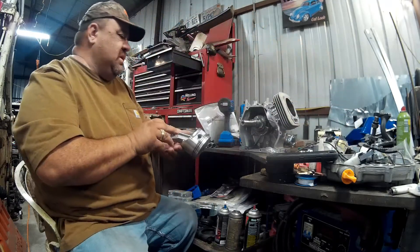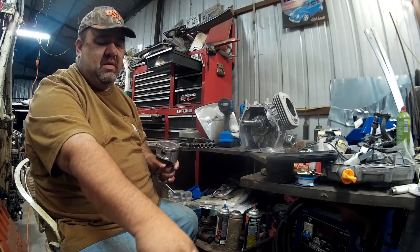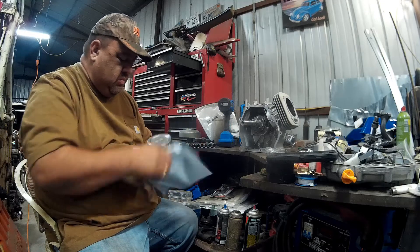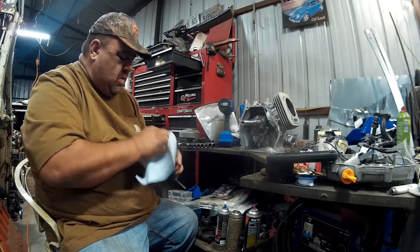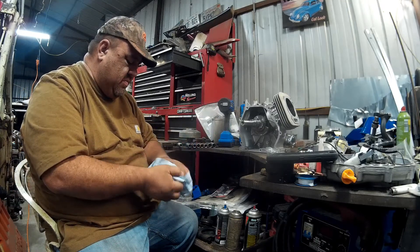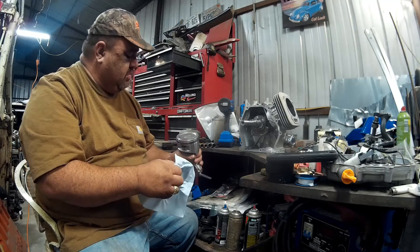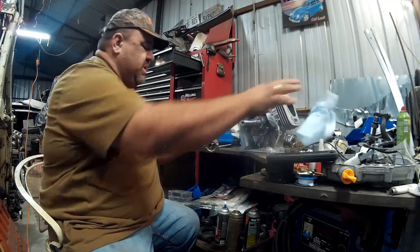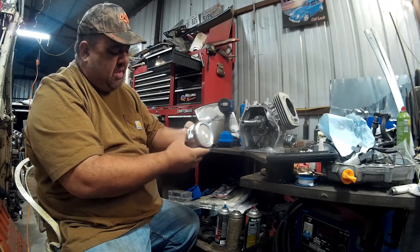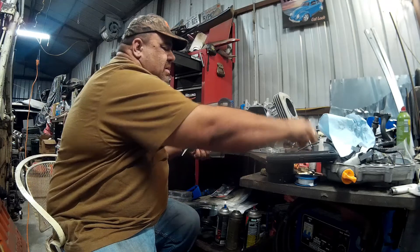Sending the rod onto the stock piston. We're not going to be revving this past 5500 RPMs on any regular basis, if at all. This is a factory new build with brand new pistons and everything — that's why we're also not using the billet flywheel. Always pay attention to the orientation: the triangle is pointing down, and that is the long side of the rod. So that's how we need to install the new billet rod.